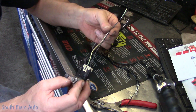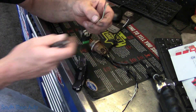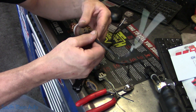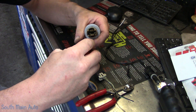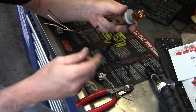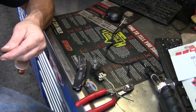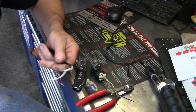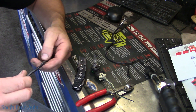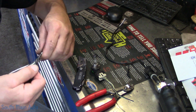I like to leave the leads about 4 inches on them. These are a little long, so I'll just take and trim these down. And then this is a dual element — a 3157. Dual element, so we've got one ground and two elements. We can choose to use both of them, because in some cases you could add twice the load, or one element is going to draw one amperage where the other will draw another, which is usually the case. One element is a higher wattage.